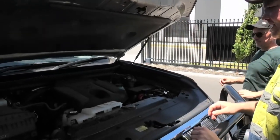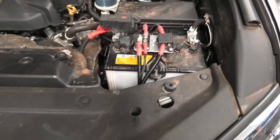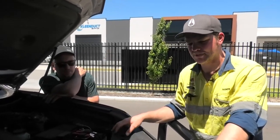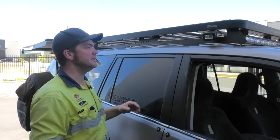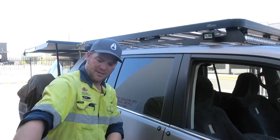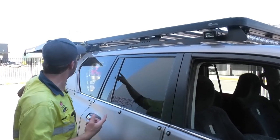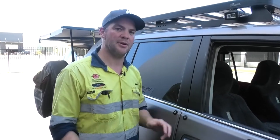There's not a lot to see under the bonnet really. All we've done is run the power supply to the back, the power supply for the driving lights, the power supply for the light bars, and we've still got a spare fuse just in case you've got something else coming up. The Rock 20 lights are set up so that for nighttime four-wheel driving you can turn the front, left, and right-hand side on, eliminating that dark spot when you pass something and can't see out of the side anymore. These are handy if it's pitch black and you're driving past something steep you don't want to fall into. You can turn the rear ones on as well, and all of those are switchable from the cab, from the driver position — while you're driving you can turn them on and off as you need them.